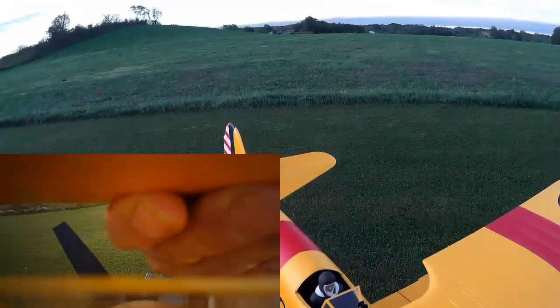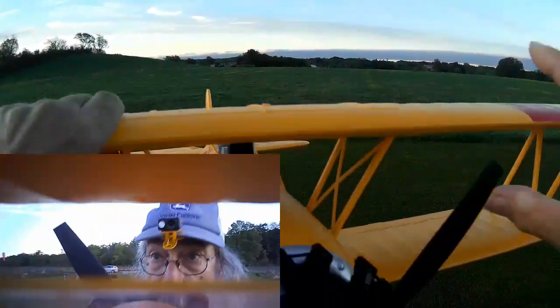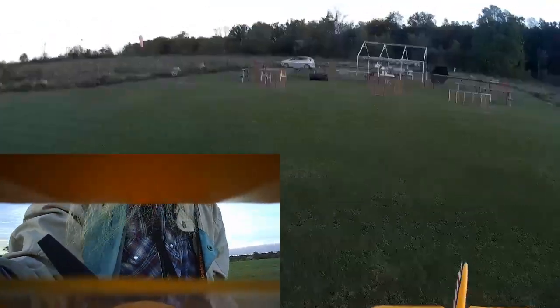Definitely not. I don't know whether you can see, but those black marks I've made on the wing there are the marks where they say 86 millimetres. Oh, well, I guess I am a bit back of that. Well, not that much back of it, though. And they say 86 millimetres plus or minus 3 millimetres. 3 millimetres is not much, so they don't really give you much allowance.